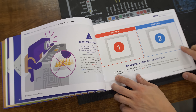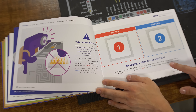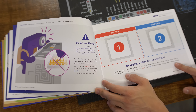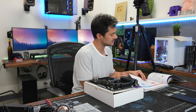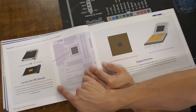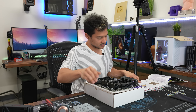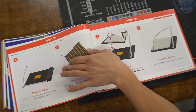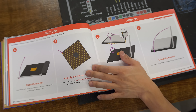AMD CPU or Intel CPU — it says your CPU will either say AMD or Intel on it. This is important as the instructions will be different for both. Keep an eye out for colored boxes labeled AMD and Intel to indicate what steps to take. Locate the CPU socket — the upper middle area of the motherboard will have a rectangular or square socket with a metal retention arm. Inspect the pins. All this section is in red for AMD, which is appropriate for our build.